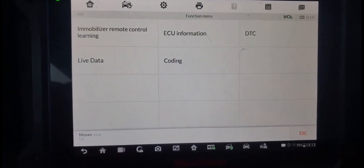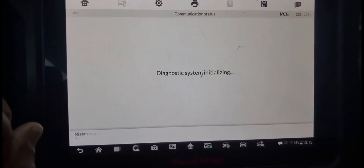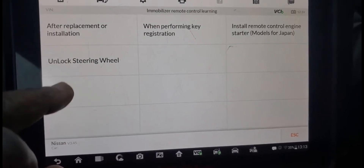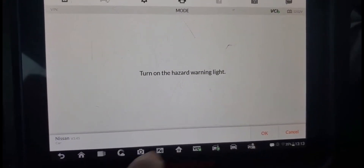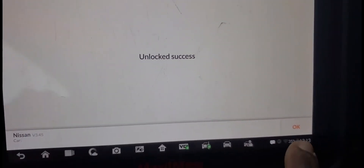Come to Emo Smart. In Emo Smart, go to immobilizer remote. Click on it — 'still unlock steering.' You're going to hit click right now. Say yes. Turn the hazard on. Yes. You see the steering column released, and it says success. Say okay.